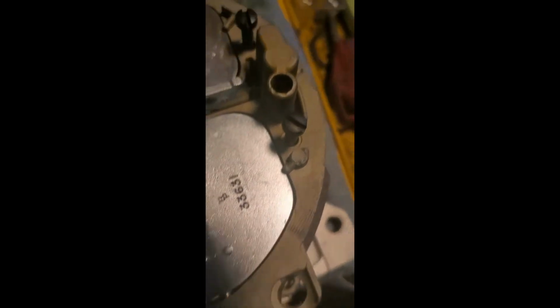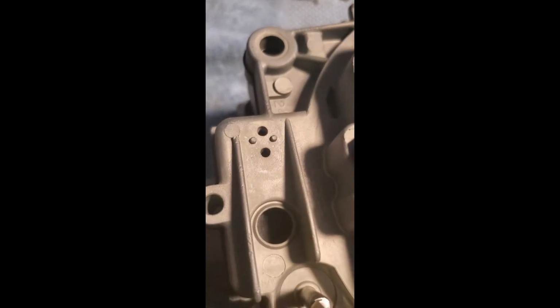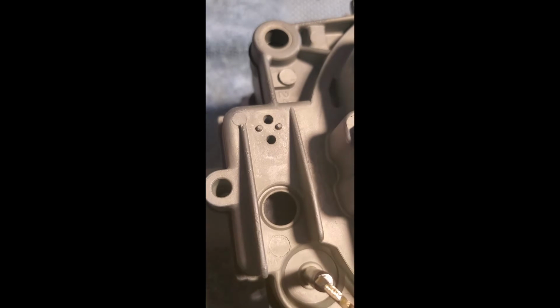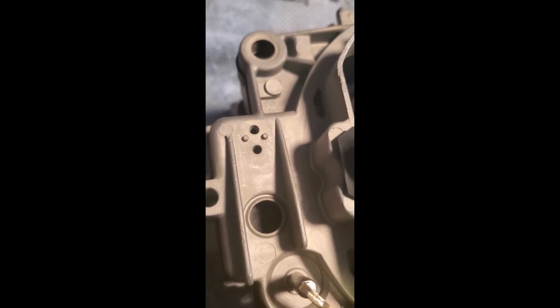Okay, to start, you have 2 flathead screws that go down in there. And there's these 2, that one, those 2. And last but not least, this one, which doesn't get put in yet because there is a vent valve that has to go there and a cover that is held on by that screw. We'll do that last. That's the last screw you tighten anyway.